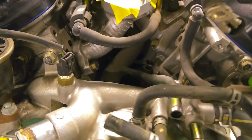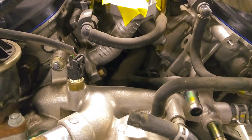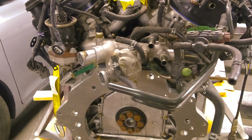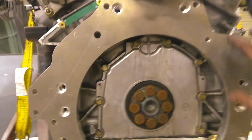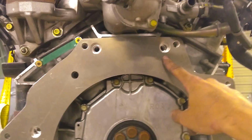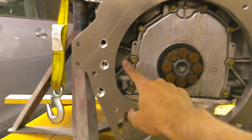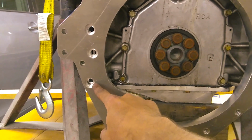That line ends up splicing into that metal tube in the middle, and pretty sure that it connects the coolant paths on the other side. But once you get that, the adapter plate will mount on. You'll end up sticking in the provided bolts that go into here, here, and then that one, and that one.